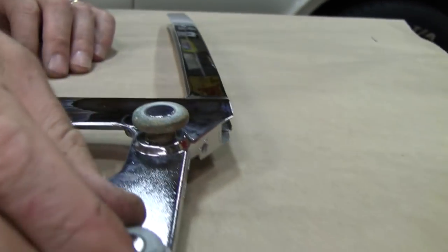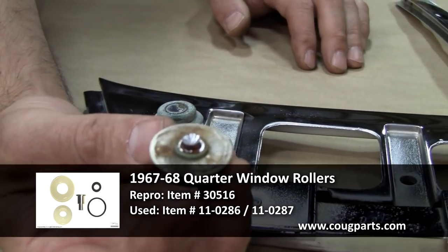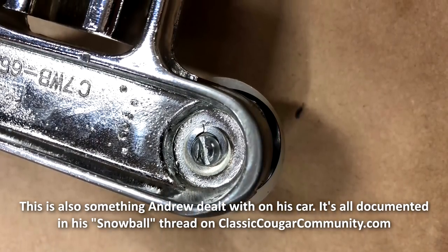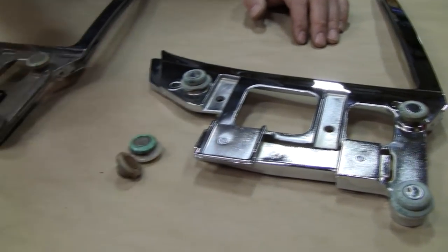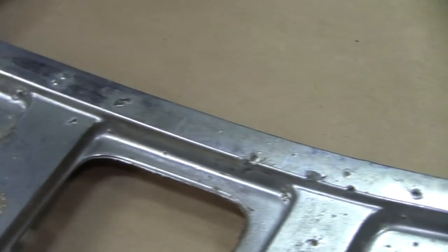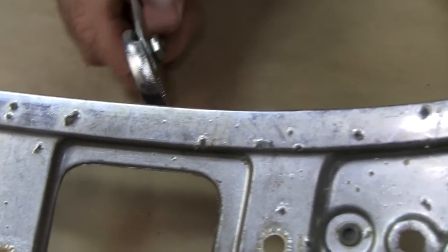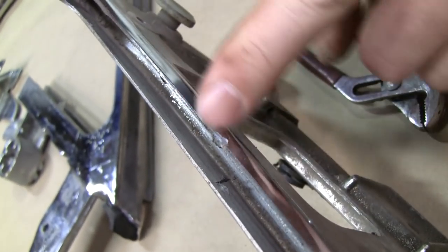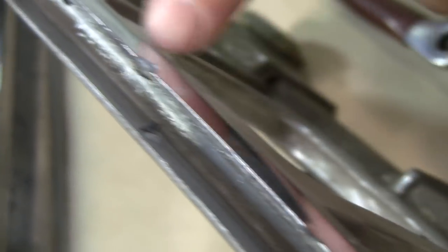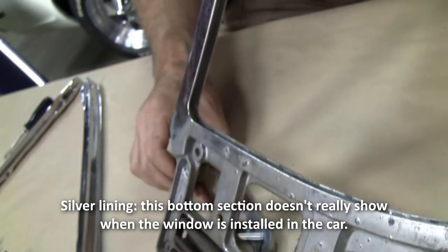They just look tired and stressed after they go through the vat, but for the most part they survive. You can drill them out, but that requires tapping them and putting a fastener in through the backside — we'll work with you either way. Light pitting is good on this; heavy pitting is going to be a problem. This core here is nice except it's compromised right in that one area — they're going to have to buff until that area completely goes away. So if you've got multiple big pits in this area, their polishing would look like this. You don't want them any worse than about that — so that's what a good core is versus a bad core.